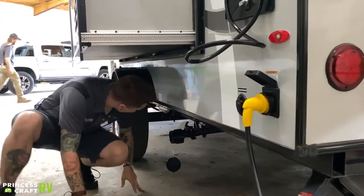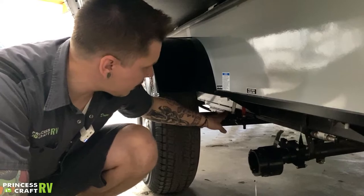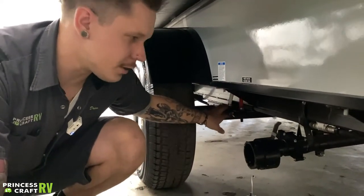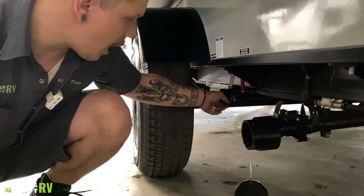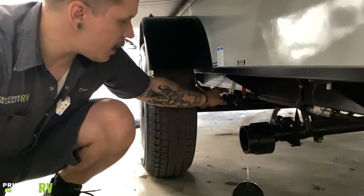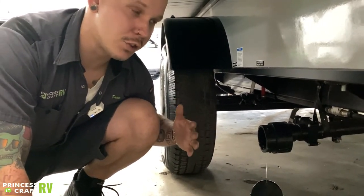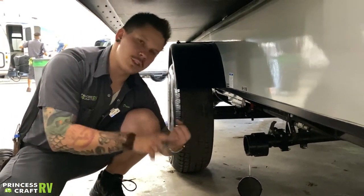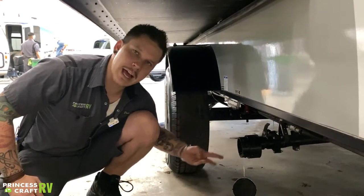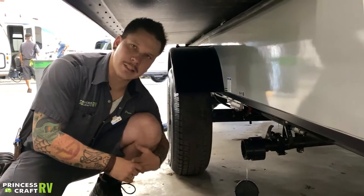Up front here, we have your low point drains — these are the lowest points in the unit's plumbing. Use these to drain the to-and-from plumbing — everything between water source and fixture drains via these two lines. They have valves: against the flow is off, with the flow is on. Use these not only for winterization but for good general maintenance — drain those lines and keep them clear. Anytime the unit is going to be in storage for more than seven days, do so. The procedure: start with draining the freshwater tank if it's been in use, then open the low point drains, let that water drain out, and lastly drain the water heater using the process we described previously.